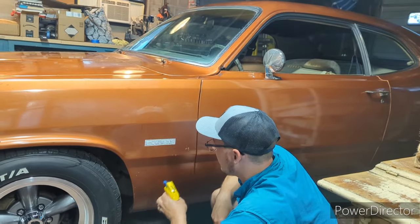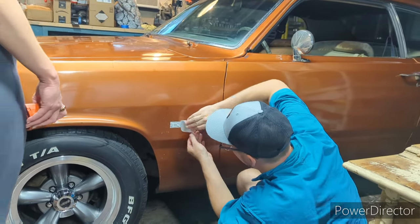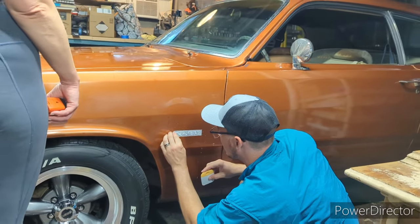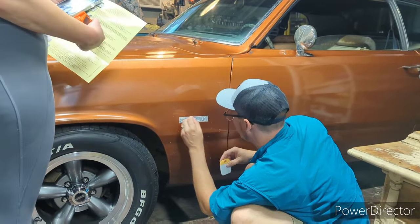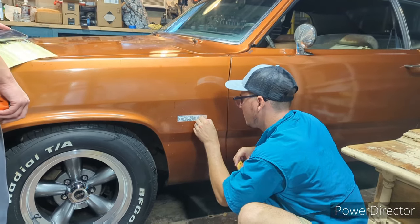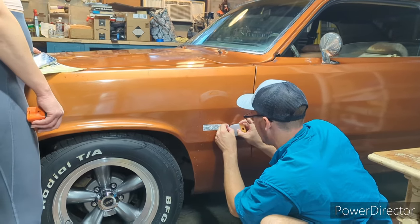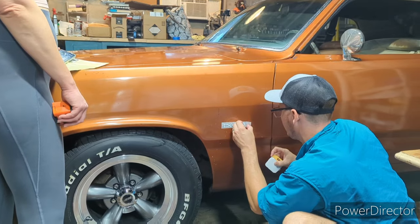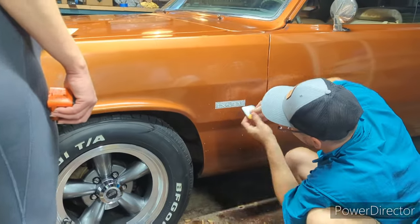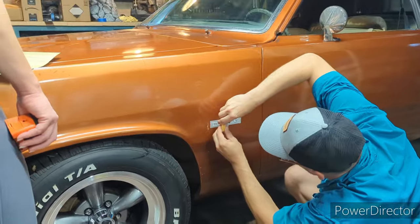Wet the tape so it'll peel off easy. Squeegee again. Nice trick, and it allows the decal to sit. The satisfying peel. It's okay. It says if it tries to pull up, you should use your thumbnail. I wonder if it's too wet. Let's see if you get some more. It says completely removing all fluid, that's why.